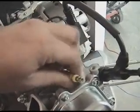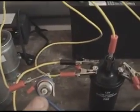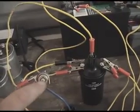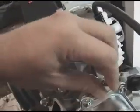Here's basically the small engine I'm using — this is a 6.5 horsepower engine. This is a duplicate of the original Excel plug. You can see this one still has the electrode on it — I haven't taken it off. And then on this one there is no electrode on the bottom; it's perfectly round. This needs to be filled with ceramic to avoid a corona effect inside the plug, because corona causes the plug to short. So we're going to fill that with ceramic so it won't be a problem.